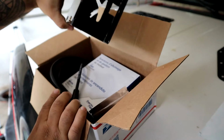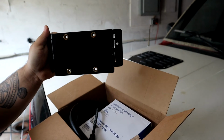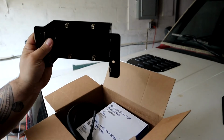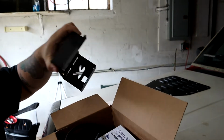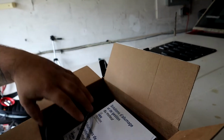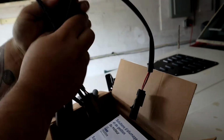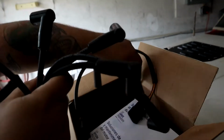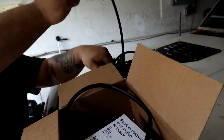And this is the bracket that's going to hold the Viper coil pack conversion that we're doing here. Got the good old Ksuspension logo there, and old Jonathan's favorite rivet nut right there. Now the cool thing about this is it's going to mount to the coolant reservoir, the overflow. And then we got some good old spark plugs here, because we are getting rid of that coil, so now we can run some plugs and wires.